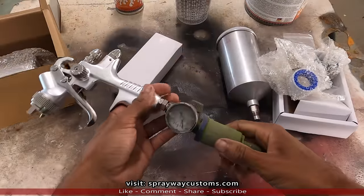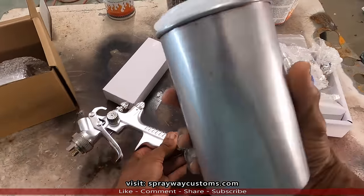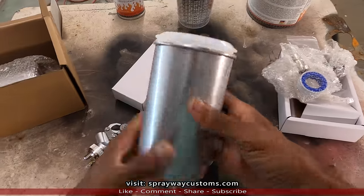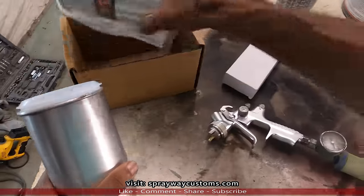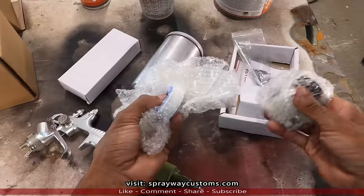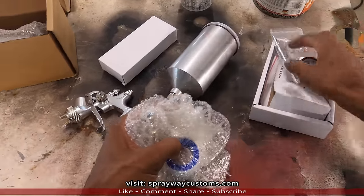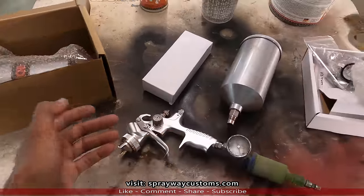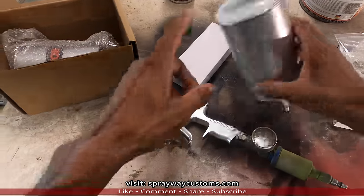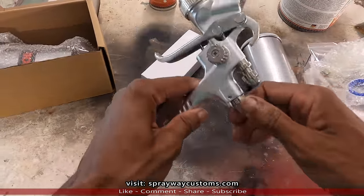Okay, here we go. Like I said, I was gonna use a different regulator. And I found an old cup that I could use. But I'm gonna use the lid that came off the new cup. So whoever wins the giveaway, they have a fresh regulator cup. Only thing gonna be used is actually the gun and the lid. But this is how I got my gun set up.